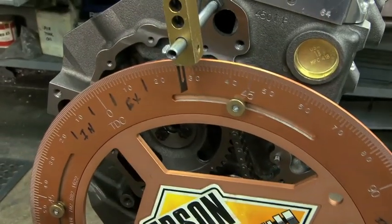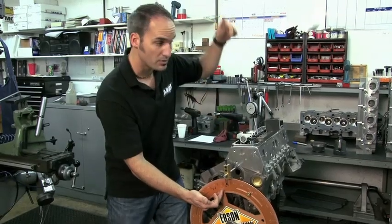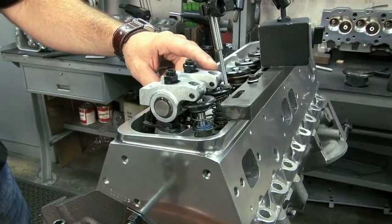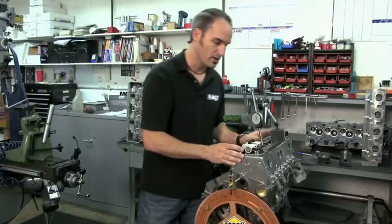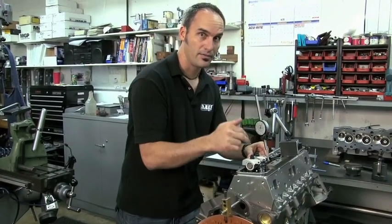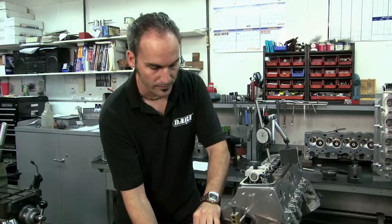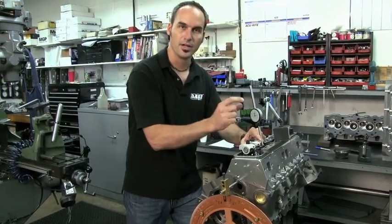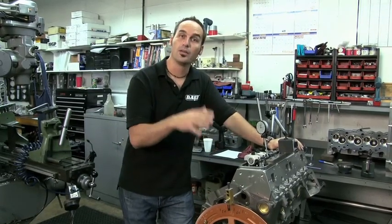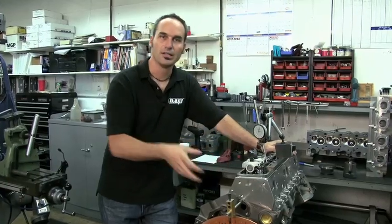So those are the two areas. I backed up a little bit and you can see the piston is chasing up my exhaust valve as it's closing. Typically, 15 to 5 degrees before TDC is where I want to start measuring on my exhaust. If I keep going, you start to see the intake drop before I even hit TDC — it's actually starting to chase that piston before it comes back down. On the intake side, typically 5 to 15 degrees after TDC is where I'm going to have minimum clearance. I've got everything set, my lash is at zero. I've got mechanical rollers in here even though it's a hydraulic, and my cam is acting on that valve. So anything I do to over-stroke this arm is my piston to valve clearance. I can keep measuring about every degree, bump it, measure it again, write down my numbers. Now I'm going to have a plot that shows me piston to valve clearance over crank angle — that gives me the most confidence of what I've got and where. Because if I retard or advance my cam, I'm going to move that clearance around. So it's a great method to walk through both sides, take an exhaust, get your clearances, know what you've got.